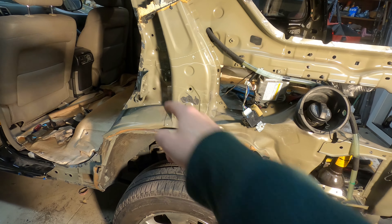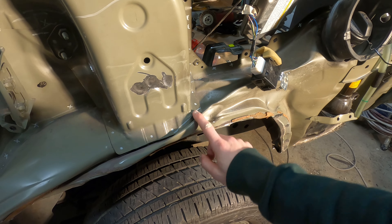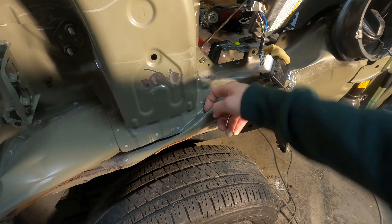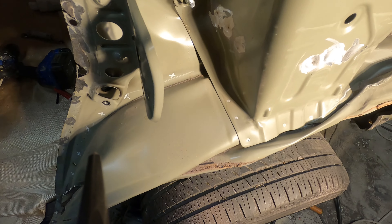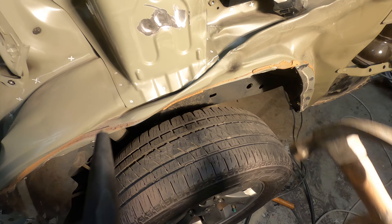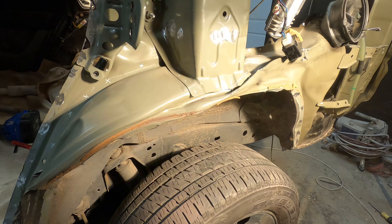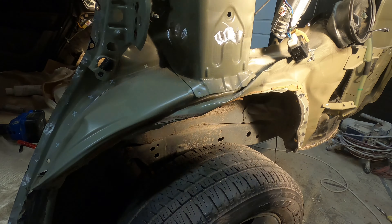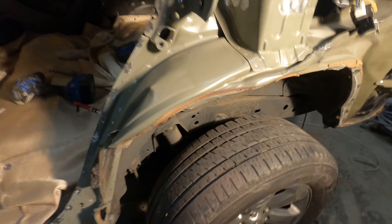Let's go in and get this section removed — we'll drill all these out first. This piece of metal right here is on top of a spot weld that I need to get to and drill out, so I'll figure out how to bend this back. So I went ahead and center punched all of these. Let's see if I can unbend that thing. We're just going to stick a drill bit in there when we get to it — let's go ahead and grab that drill bit and start drilling.